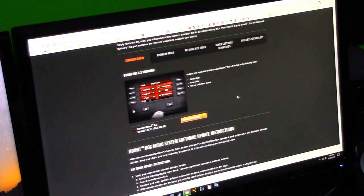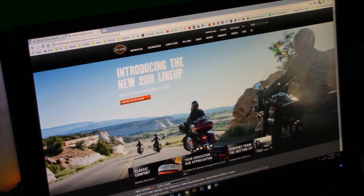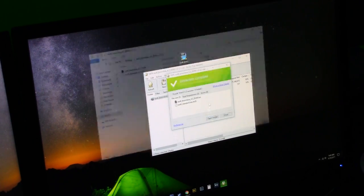Click Save to save the file to the desktop. Make sure your thumb drive is completely empty. If you have songs and pictures on there, slide them off into a new folder on your computer, format your thumb drive so it's empty, and you can always move that stuff back later. Once it's downloaded, find the zip file on your desktop and double-click it to unzip it — just put it on the desktop.